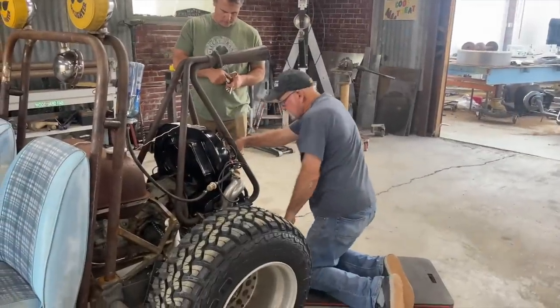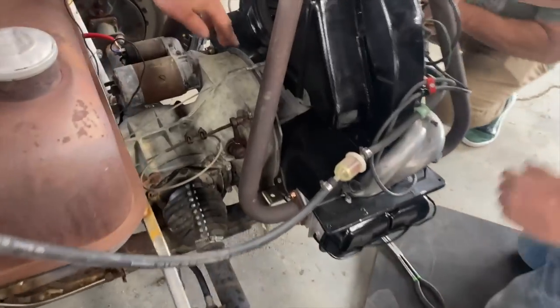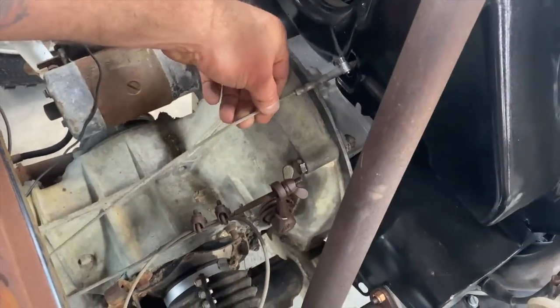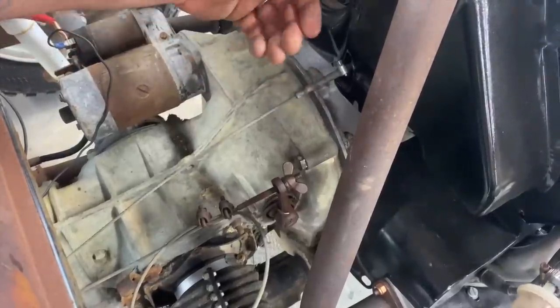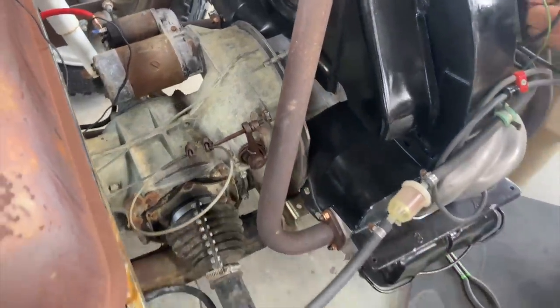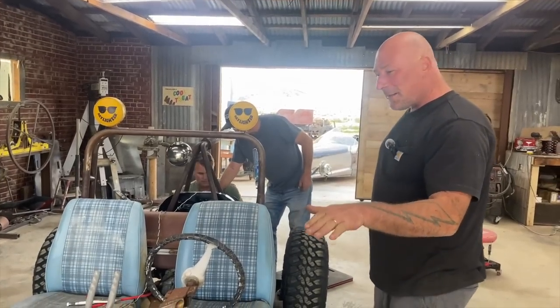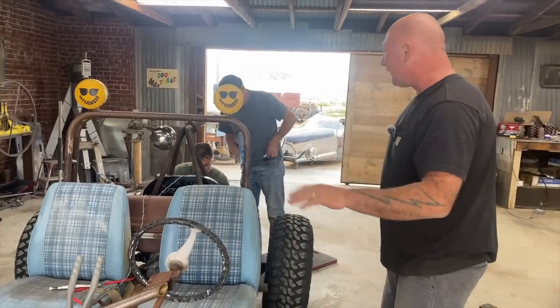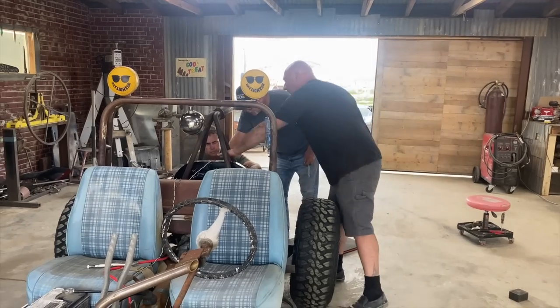The angle of the dangle on the accelerator cable looks reasonable. With a buggy or any kind of custom build, you want to make sure it's not binding up. I'm not going full throttle — we're just doing a test run. We're just trying to see if first gear actually engages. Preparing to pedal — ooh yeah, that's awesome. That's what we're trying to avoid: you put it in gear and step on the gas and it just stays on. Do you think we need a stronger return spring on that carb? It's a pretty good spring. Everything seems cool — we're not going to get out of control.